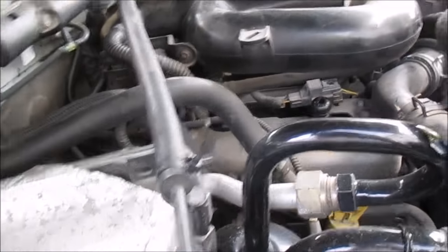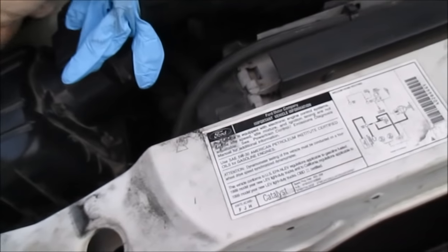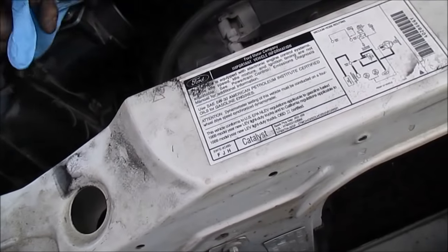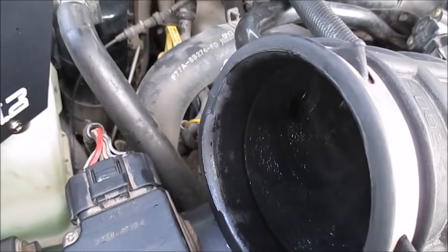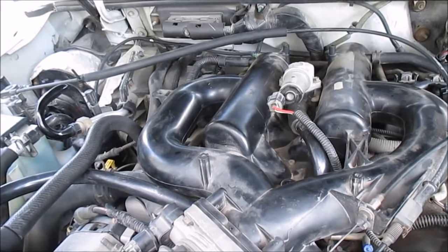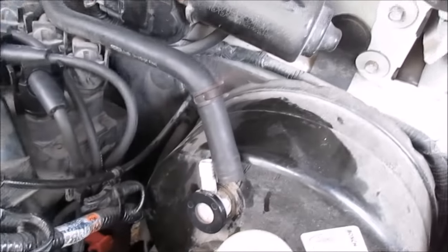Let me look on this side for a minute. Just broke — I'll get another glove. As you can see, that's what it will look like. I turned this thing off a couple of minutes ago and it's still coming out here, so it filled up pretty good. The only place I saw it coming out was at this fitting right here, and leaking out down by where the intake is. I think that confirms that I got a leaky intake. I'm going to create a leak over here on purpose to see if it comes out.